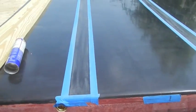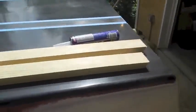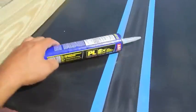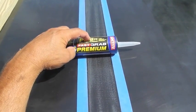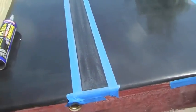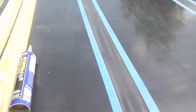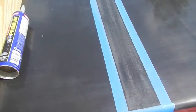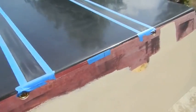I'm going to try not to drill through the hull. I actually got some regular 3M 5200, but I really just absolutely hate that stuff - it doesn't stay where you want it, it's a pain in the butt. So I'm thinking about trying PL Premium, because I've used it some and I love it. This is the fast grab version - they say eight times stronger, the other stuff says three times stronger. I called West Systems and asked them how to prep the graphite, and they said for a mechanical bond on graphite with epoxy, just deglaze the top with some 220. So I figured that would be good enough to try this. Worst case scenario, I put these on and they just fall off, but I doubt that's going to happen.